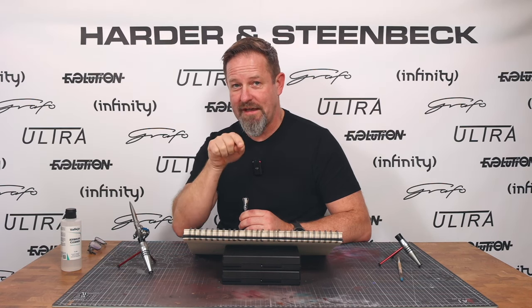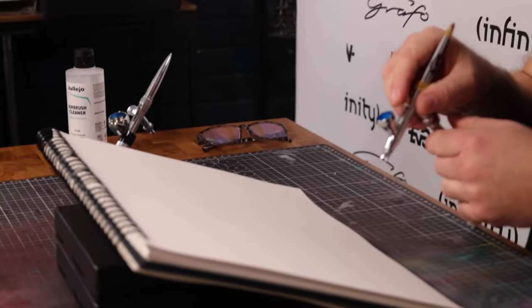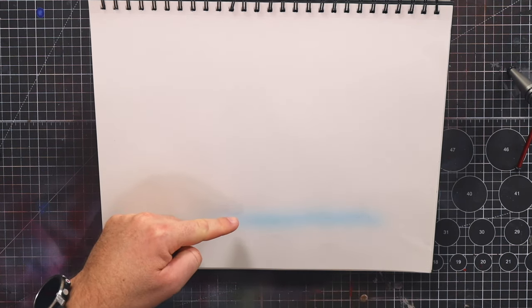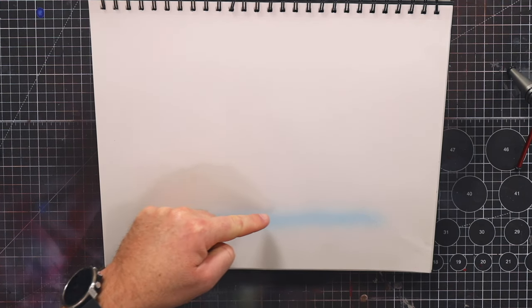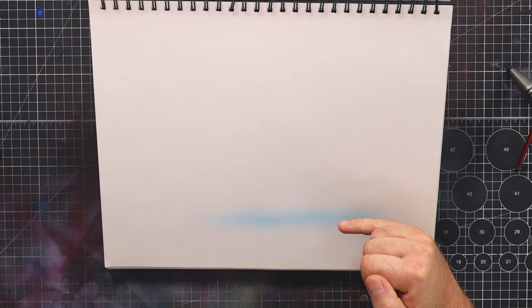The second stroke — and this is the key — you aim the center of your second stroke at the edge of the previous pattern. So if we lay down a line, I'm about a fist distance away with a nice bit of spread. Because I started moving before I pulled back on the trigger, I've got a really nice feathered edge to the start, and because I didn't stop moving before I shut the paint off, I've got a nice feathered edge at the end. The second stroke — I'm going to aim the center of my second pass at the edge of the spray pattern, and that is what will give me perfectly even coverage.